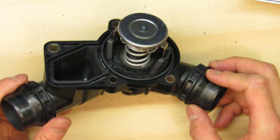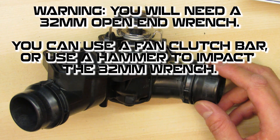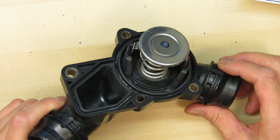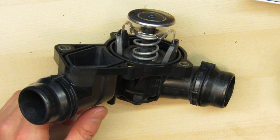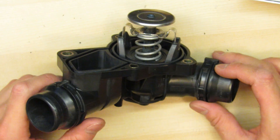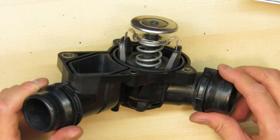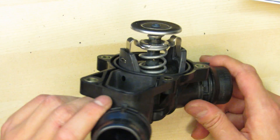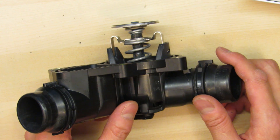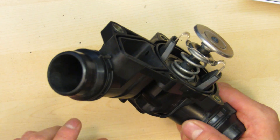The part is about $100 online and it takes about 3 to 4 hours to replace. You need a 32mm wrench, and you should have something to hold the fan clutch still. To get the fan out, take the 32mm wrench and hammer it in the clockwise direction to get it off, then counterclockwise to put it back on. The pulleys have enough inertia to hammer on the nut without a fan clutch bar. Note that the fan uses reverse threads, so you turn it clockwise to unscrew it.